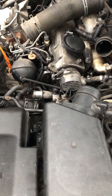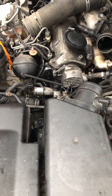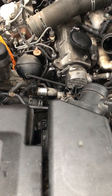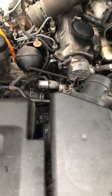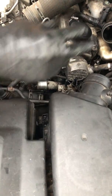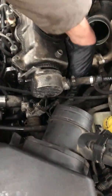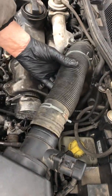The symptom was that the glow light would only stay on for a few seconds, even less than that, so it appeared as if the temperature sensor was the problem. I located the unit — it's down, really can't see very well, but if you remove this hose you can get at it.